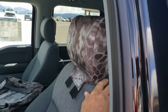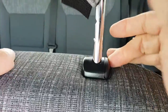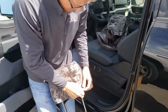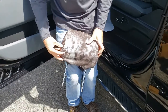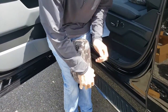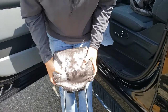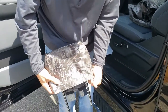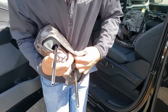Next, I'm going to recline the backrest, then lift the headrest up and depress the two buttons on each side to remove the headrest. With the headrest low, I'll pull it down and center the headrest cover — I can see it's a little too far one way, so I'm going to center the seams on that headrest by twisting it. Get those headrest seams centered, pull that down so everything's looking nice, then tuck the velcro behind the back edge and press it down.